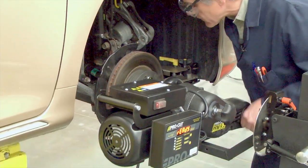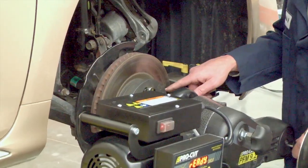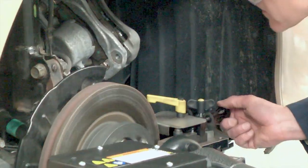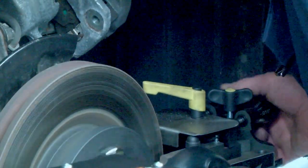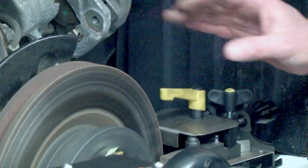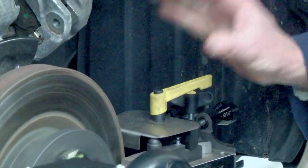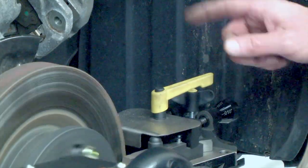Now we're going to establish the depth of our cutter. I'm going to rotate the feed knob and move the cutters in about midway into the rotor lining surface. I'm going to turn on the motor and then rotate the cutter depth knobs just until you hear the cutters lightly touch the surface of the rotor. We have the rear cutter bit and the outer cutter bit just barely touching the surface of the rotor — that's going to establish what we call our zero point. I'm going to lock the levers down. If we don't lock these levers down, we don't get a good cut, so try to remember that step. Every time you make an adjustment on those cutters, you need to re-lock this lever.